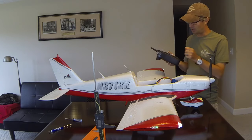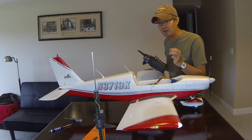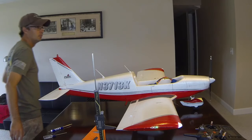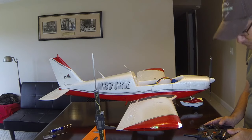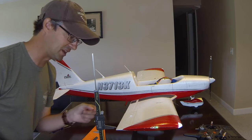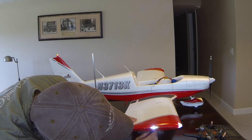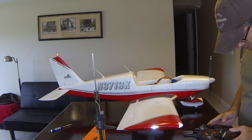We now have the height gauge set on the tip of this aileron. We'll loosen up the push rod adjustment and tweak the aileron. Screw loosened — changing trim to zero. Now we adjust this aileron accordingly. Because the push rod is loose and the height gauge is set, the aileron will actually stop right at the correct point. Easy as that — this aileron is now adjusted, trim is set to zero on both ailerons.